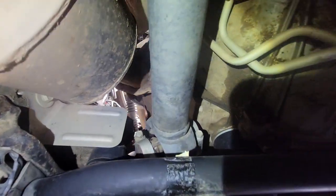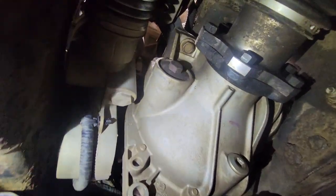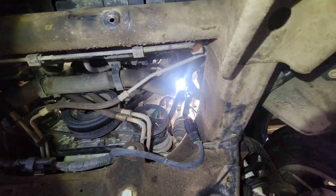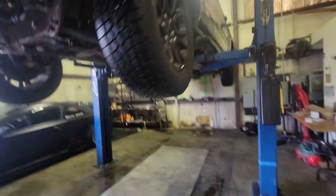Today we have this 2018 Chevy Silverado and we need to change that motor mount right there. It is difficult on this vehicle because this is the four-wheel drive system, the C71 Chevy Silverado, and you have the front differential here in the way, not to mention the drive axles and all that stuff. The way people usually get this done is drop all of this here, which is going to be a mission.